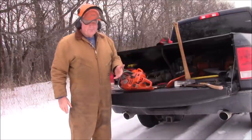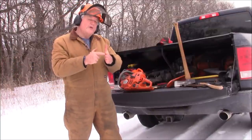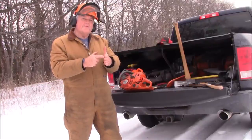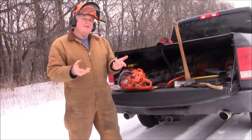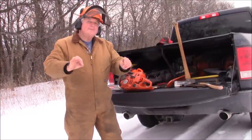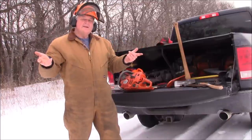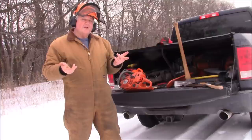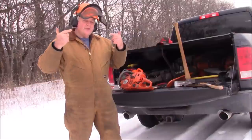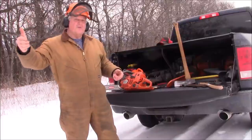So what'll happen is this thing is kicking along, and the Autotune will hold that little solenoid closed for a couple of revolutions, right? Now what will happen is that's going to lean the mixture out just a little bit. If the RPMs pick up on the saw and it's detected by Autotune, that means it needs a little less fuel because it's running a little bit too rich. If, on the other hand, the RPMs drop off, that means it doesn't have enough fuel, so it'll add a little more fuel in the next set of cycles before the next test.